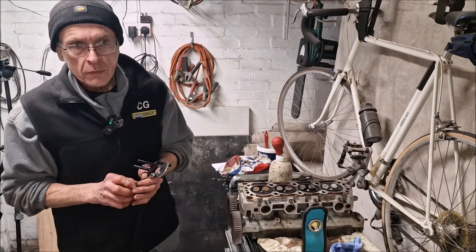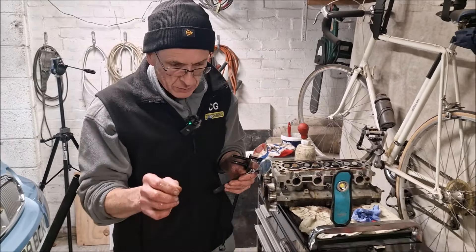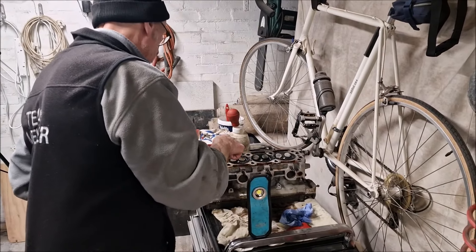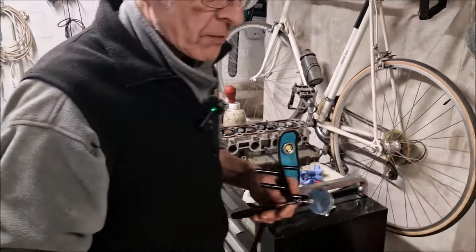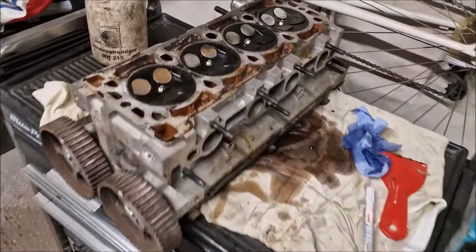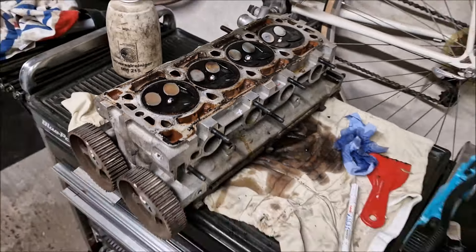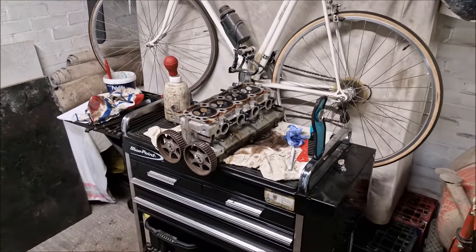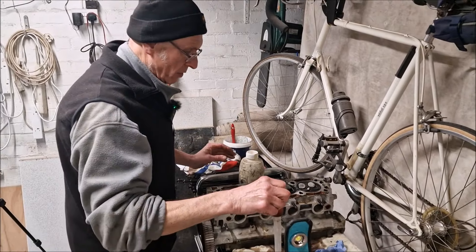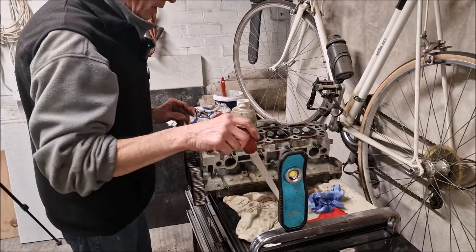So you've done your white spirit test - what have you found? Valves are leaking, some of them. How many? That inlet valve's leaking and that exhaust valve's leaking. So that'll be new valves? No, I don't think so. Just re-lapping them in? Take them out and clean them and put them together. It's just another year's work. Is it quite a big job? It's fairly time-consuming, yeah.